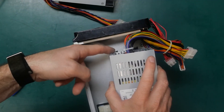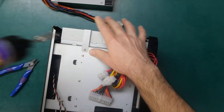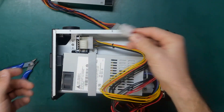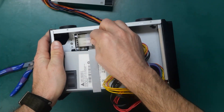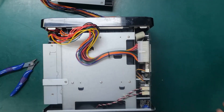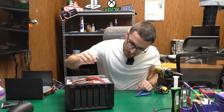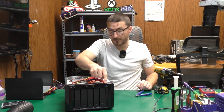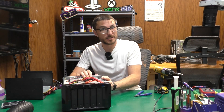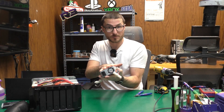We have a few zip ties and let's install our replacement power supply. My replacement doesn't actually have the tabs at the end but that's okay. We'll plug the first connector in upside down and the second one right side up, then plug in the motherboard. Plugging it back in — I already see my blue light coming on and my fans are spinning, so let's set it aside for a couple of minutes while it initializes.